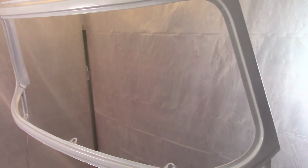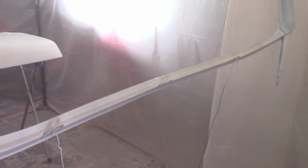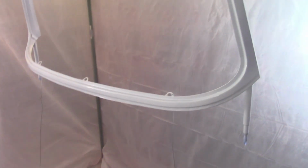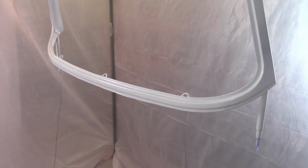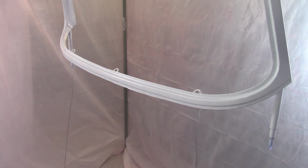You may have noticed there that I kind of stopped and came back at painting. Turns out I ran out of reduced epoxy. So I mixed them up real quick and shot it. It's not unprecedented to not allow the epoxy primer to activate for 30 minutes. I know a couple guys on the forum that just mix it and shoot. So I figured it was better to just mix and shoot than to wait the 30 minutes and allow everything else to dry, or just to not get a sealing coat on there at all.